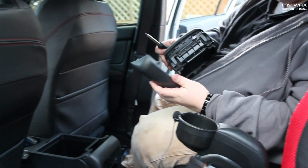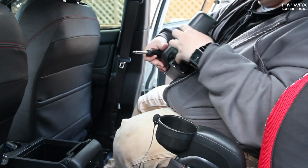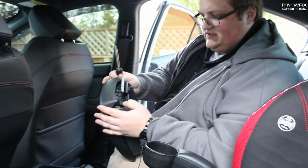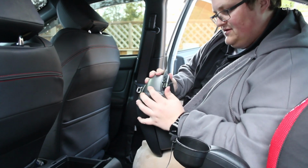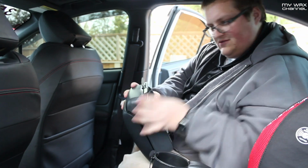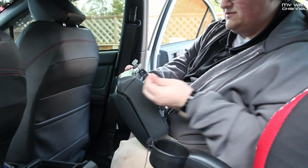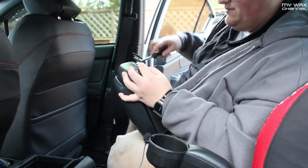Now, you're going to take the back cover that came with it, and it's going to cover up this top hinge up here. You're just going to line it up. There's 2 screw holes here. You line up with there, and you just push it on, get everything lined up, and it clicks on. Once that's on, you're going to take the 2 taper-headed screws that you got, and they're going to go right in these holes because they have the tapered seat for them.